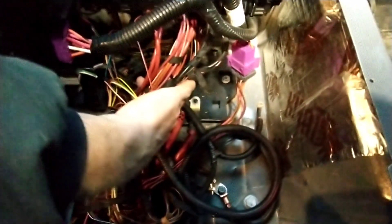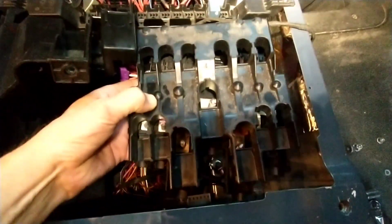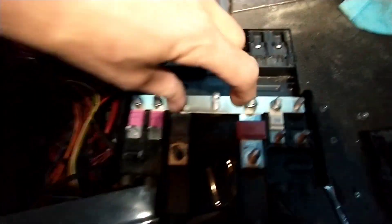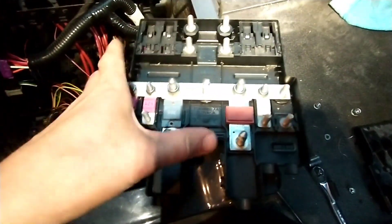This module down here, the R150F, you have to disconnect all the terminals off it. Somewhere around 7 things connected — I think 6 on mine. Once you get it out, it's got a cover on it when it's in the van, so it's going to look different. It's down underneath there. You pull all the terminals off of it and number them. Then this comes off with some clips, and then the whole thing lifts out with a pinch clip in the middle. It's pretty easy.